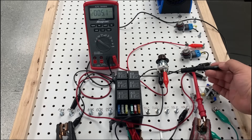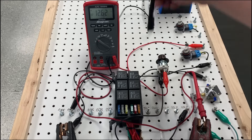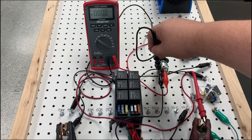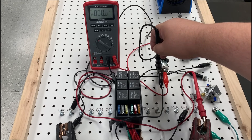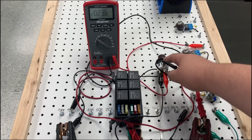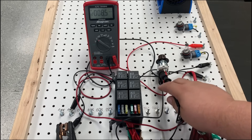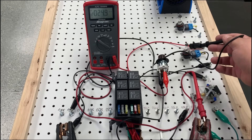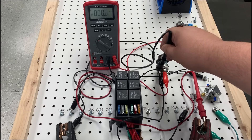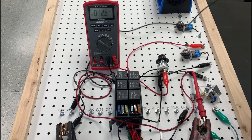So let's walk our meter. We're going to take our lead and go to the output side — I have 12.6. Now let's go to my input side — zero. Remember what I told you: if you're at zero, there is no current flow. This resistance is set so high that there is no current flowing between these two points. This is why this light is dead — if I go back to my input side it is showing zero, which means and verifies there is no current flow in this circuit.